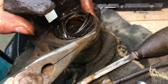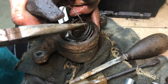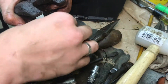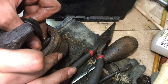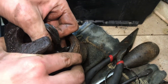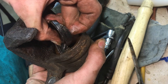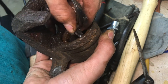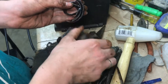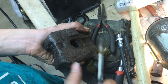We can go ahead and take out this wire — it's the thing that's holding all this rubber boot in. You can tell this one's not in great shape, that's why we have a new one. Now this rubber boot should come out a bit easier. I'm just working this rubber boot out — and there it is, the rubber boot, which is not in very good shape. Now I'll just go ahead and scrape some of this scale off to get the major stuff off, and then we'll get the rest with the wire wheel.